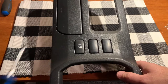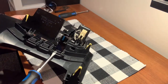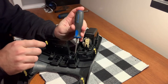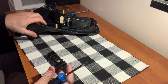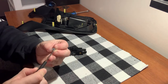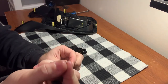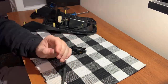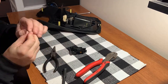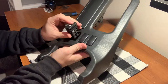The next one we're going to replace is the downhill assist control. Flip it over and you'll see a tab here and an identical tab on the other side. Push this tab and it tilts in, same thing on this side, and it'll slide out the front. Once you have that removed, you're looking for the little light right there on the side. There's the bulb and the wires. After you put the new LED in, put it right back in the slot and it'll just pop in.